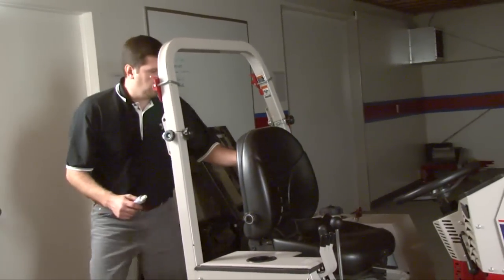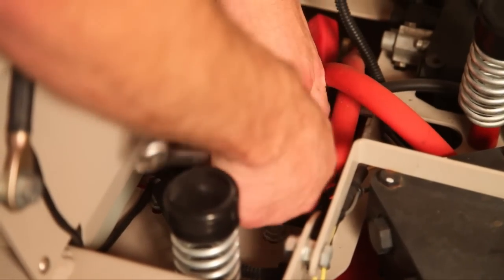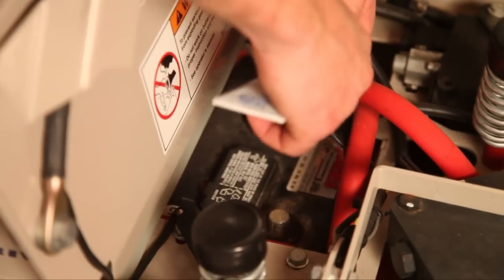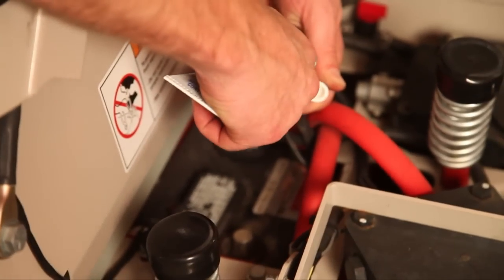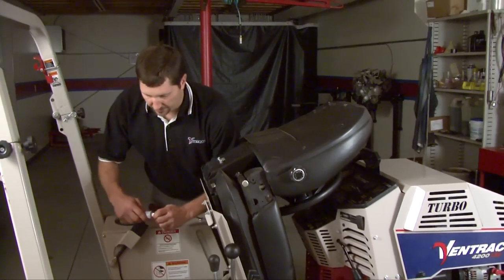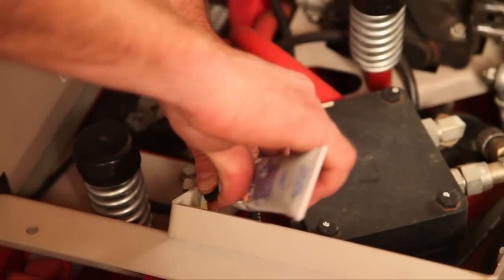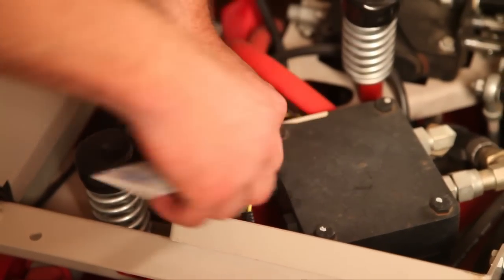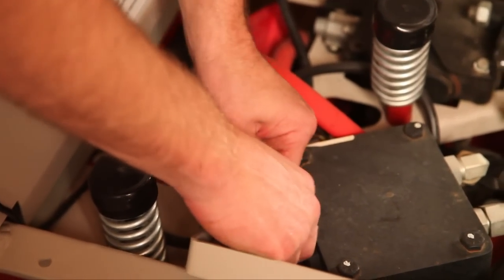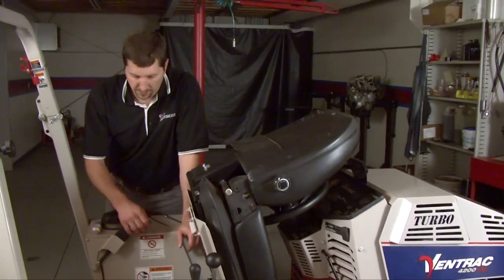After that, let's stay here at the back. We'll flip the seat up and look at the battery terminals. For safety, take the negative cable off first, clean it up, and put some dielectric grease on there so those terminals don't start to corrode. Leave that off while we do the positive terminal next. We've also got our rear light plugs back here — coat those a little bit. Some of these you'll have to remove the nylon tie straps to access them. If you've got a rear salt spreader doing heavy snow and salt removal, these areas will get coated eventually, and this will help protect those terminals.